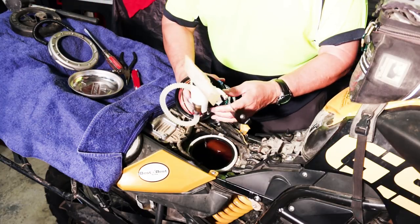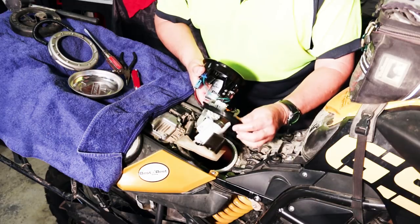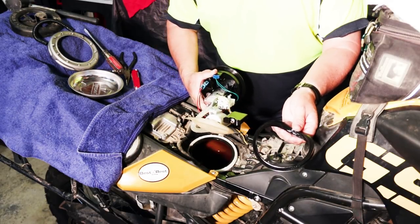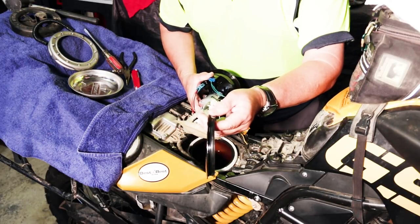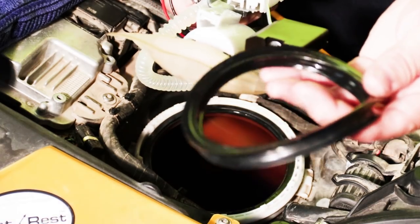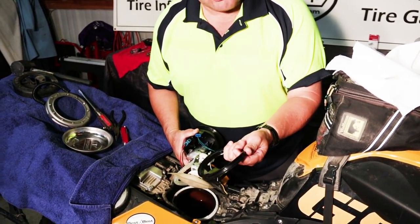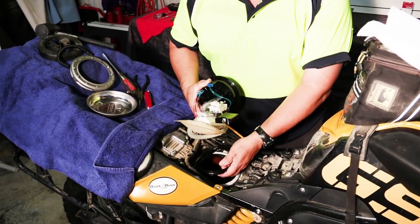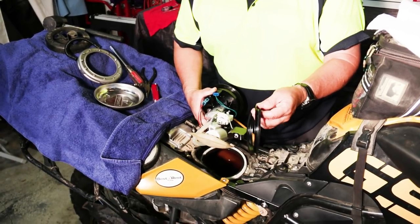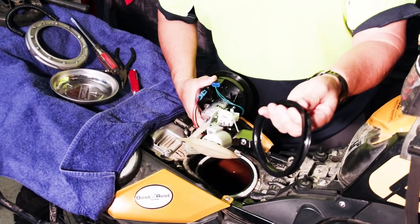Once we have this out, shake out as much gas as you can, then remove the O-ring by gently working it around and off. There's an up and a down on this O-ring: the larger part of the flange is up, the smaller part goes down inside the tank. Important tip: I started filming a couple weeks ago and when I first pulled this out the O-ring was soft and pliable — but two weeks later it had become hard, brittle, and too small to fit. If you won't have all parts ready within a few hours, put this gasket in a tray of gasoline so it stays pliable.